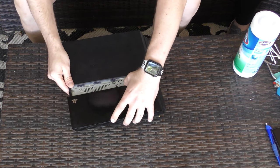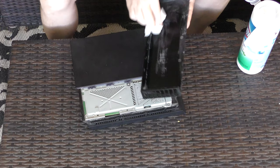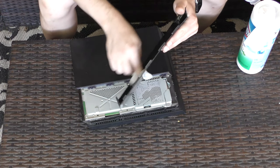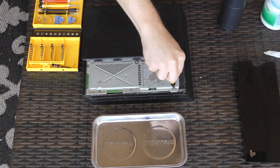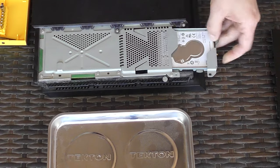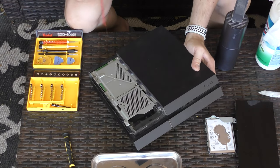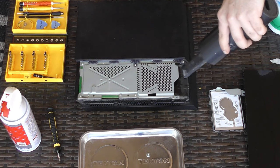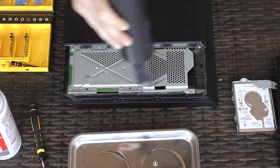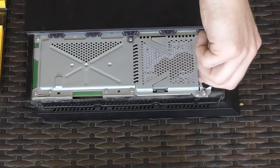First, let's clean out the hard drive bay. It is not secured with any screws and you simply slide the cover off to expose the bay. I haven't opened this cover for at least three years when I upgraded the hard drive to one terabyte. Remove the screw and unplug the hard drive by pulling it out. Use small bursts of air to clean the hard drive and the cage. Wipe down the dust settled on surfaces. I use disinfectant wipes to help with getting the stuck-on dirt to come off. Reinstall the hard drive, the screw, and the hard drive bay cover.